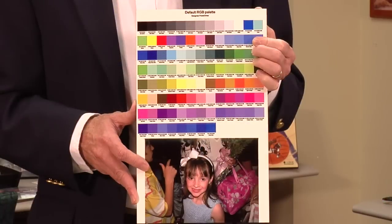I hope this video has been helpful in walking you through the methodology for determining where your problem is coming from. The bottom line is this: print something you can use as your stake in the ground to know how your system is working. Then, if you do encounter problems, first look at what's changed — has somebody reinstalled Corel, or are you using a new version that requires some setup? If you're paying attention to your system, you'll probably spot a change. If there hasn't been any change, go through the methodology I've suggested. Also, if you're not using your printer a lot, your inks could age. Pay attention to the use-by date on the cartridges, because the signs of a cartridge going past its life are that the inks will weaken — the magenta won't be as strong, your color shifts, and it might appear like other colors are overpowering.